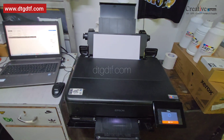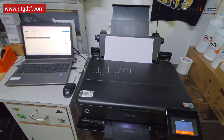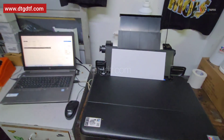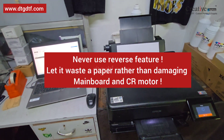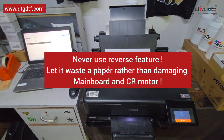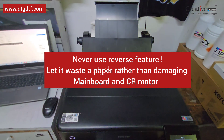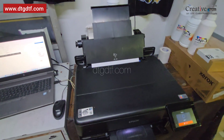This printer is a fantastic option over the 18050 or 8050 because of its CR motor. There are other versions similar to Zigroll that offer forward and reverse, but I will not recommend using the reverse functionality on these printers via software unless you modify the printer somehow, because it will damage the CR motor.